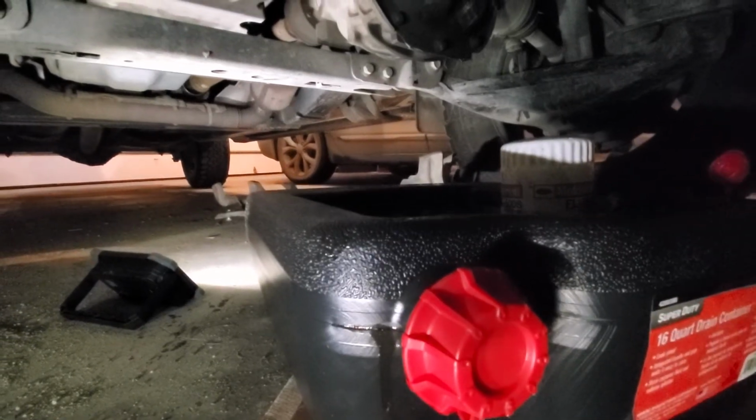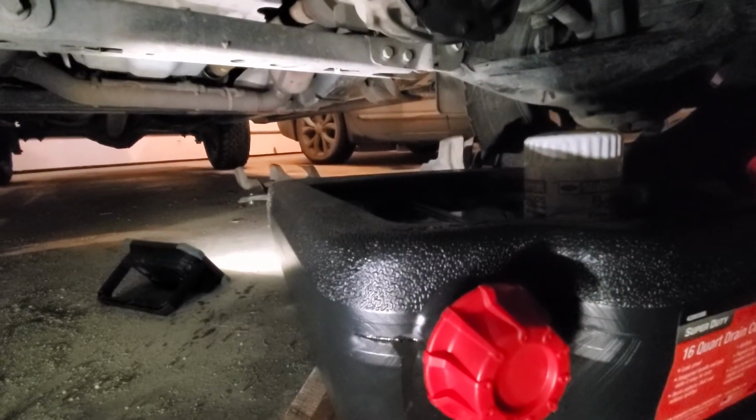Very. So, of note, this bolt that's on here has a small rubber gasket around it, and you want to make sure that stays on there and you don't lose it when you take it off. That happened on my 84 Supra, warped a rod, destroyed the engine, no good, because I lost all my oil.